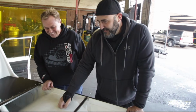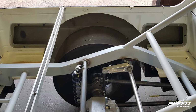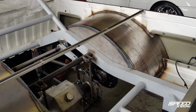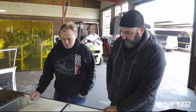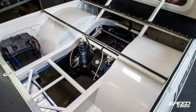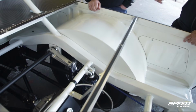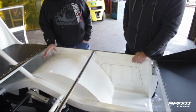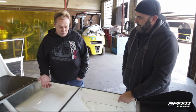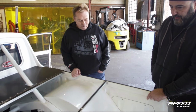This, all done by you? Yeah, all the fabrication work I done myself. It's just the chassis legs that came in on that shape. It's a chromoly competition engineering chassis legs. All the linkages made myself, also chromoly tubing. The beauty about this is that it looks like original, like it comes. It goes so well with what you've done with the rest of the car as a package. That's the main idea I had in mind, was to keep the section white at the back, and then you can get the aluminium tubs, but to join them onto the steel body, you got to rivet them. So I made the steel tubs and I welded all of it in place.